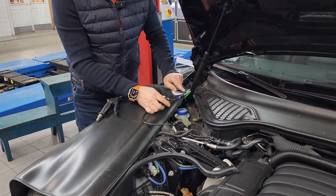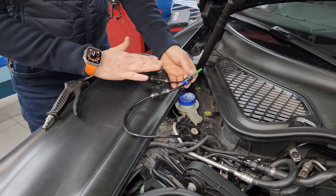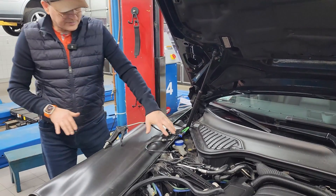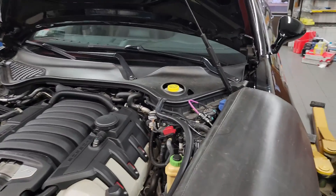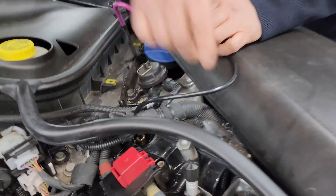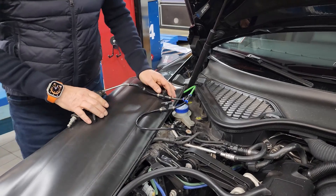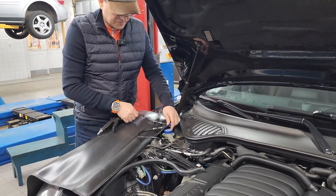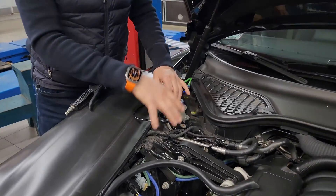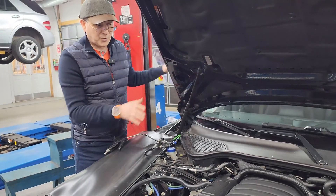This green line is the vehicle line that would go there otherwise. For the right front suspension we have this system with two valves — I'll explain in a minute why there are two valves on the right side — and then on the left side and both rear wheels you have this valve, fitting, and line. You need at the very least these two to get started. This one allows us to fill the system with pressurized air and pressurize the struts, turning off the air strut from the rest of the car's lines on all two or four wheels being tested.